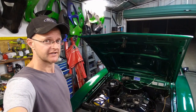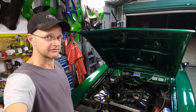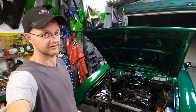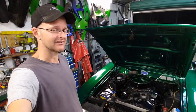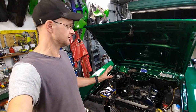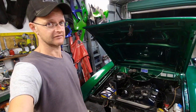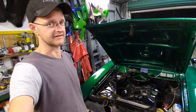Episode 73 summary. I took my car around to my mate Alice's place to get the timing light onto it. He has a digital timing light and he's an auto electrician by trade. He works at a speed shop, so he knows his way around a tuning situation. And he says timing is very retarded and he reckons it's one tooth too far retarded on the distributor. He said he's wound as much timing into it as he can get, and it's still miles away from being optimal. So he said I need a new harmonic balancer that has timing marks that make sense.